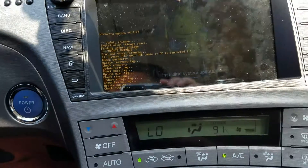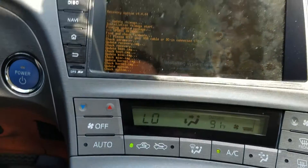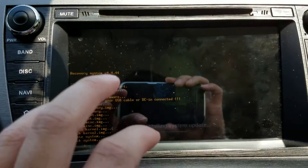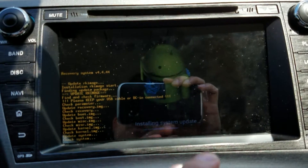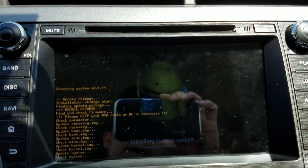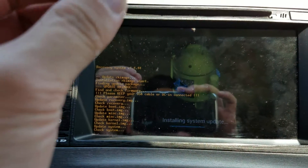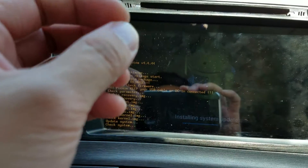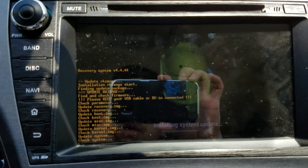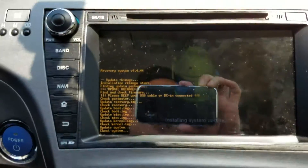As far as issues with this deck, I don't see any yet, but I noticed that most of these decks have a white screen flickering issue — when you go into a white background it starts flickering on the front here. That's actually easy to fix: all you have to do is take out your deck and tighten the screws for the display. I saw a video on YouTube about it. Most of the time everything I use is all black — GPS, everything — so it doesn't bother me.